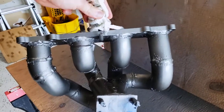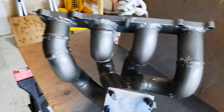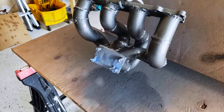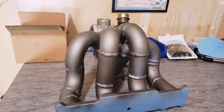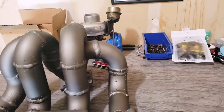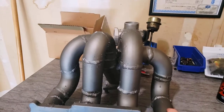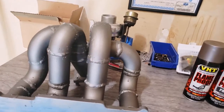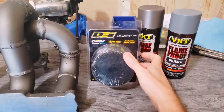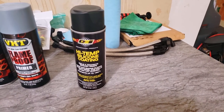Color coat is all on, looks pretty good. I'm gonna wrap it though, so I guess it doesn't really matter how well it looks. I'm gonna let it sit for a couple days to make sure it gets fully hardened before I try to wrap it. I sanded it with 120 to rough up the surface, primed it, then painted it — I used the VHT stuff for that. I did this because it's mild steel; if you have stainless steel you don't really have to, but you can. I got some DEI titanium wrap in black and I'll paint it afterwards with the high temp silicone coating.